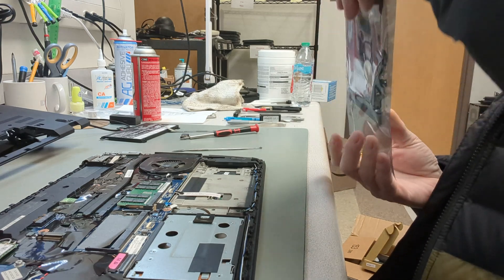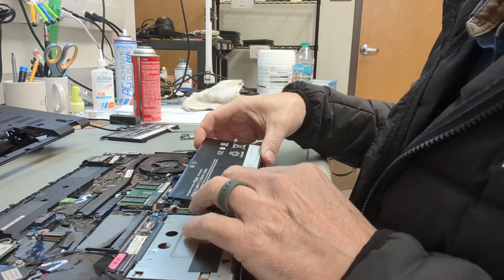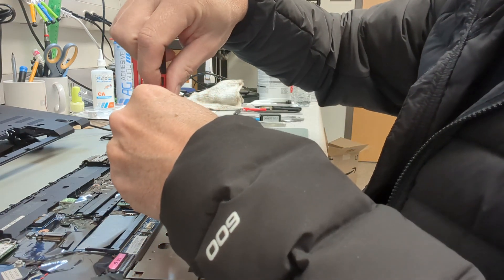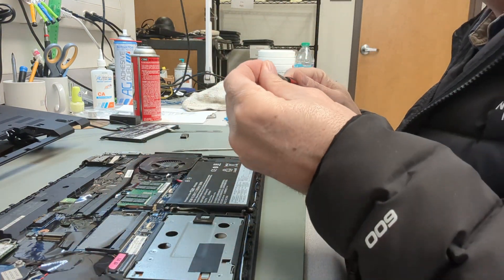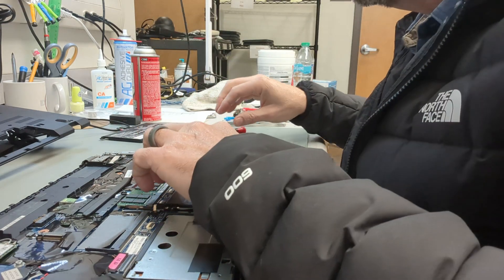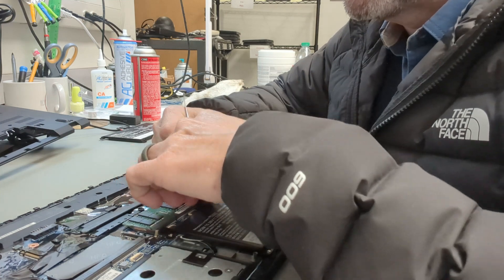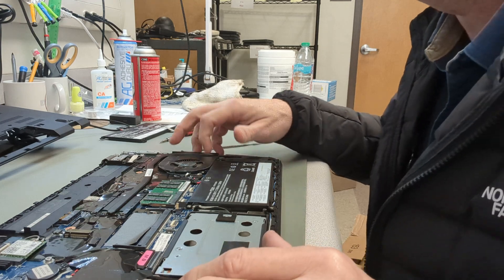Here we are back with our Amazon replacement battery — this is a no-name lithium ion battery from Amazon. We're going to set this back in, reapply the five screws we removed. This is a PH1 Phillips bit — most Lenovo products use a PH1, sometimes a PH0. Reinstall all screws including the last one in the upper middle. Now we need to work our little connector back into that slot and give it a little push — slide it right in and it works great.